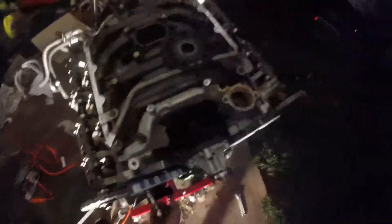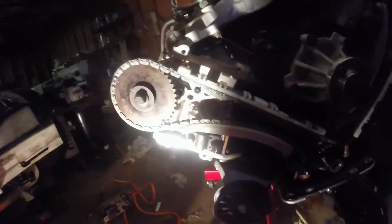That's a lot better than how it was when I took it apart. That driver-side chain was so loose, the tensioner was maxed out. It's nice this one has metal guides versus the plastic ones. Not all 4.6s came with metal guides — some came with plastic — so if you go for a timing kit, definitely try to get the ones with the metal guides. A little bit stronger, especially for what I'm going to do with it.